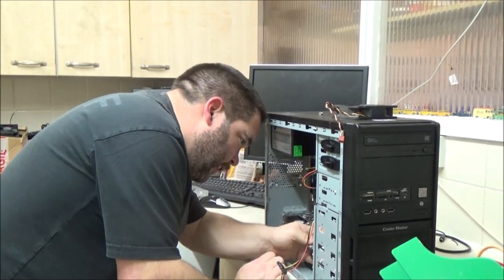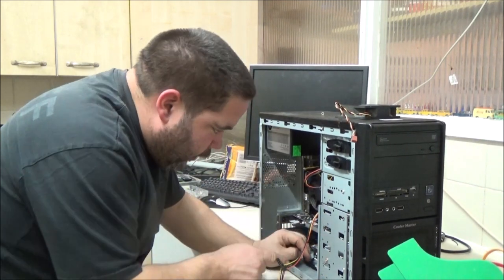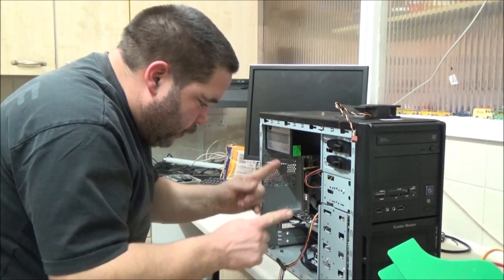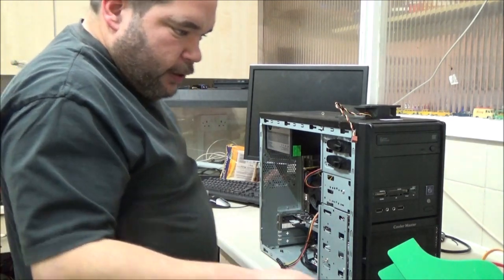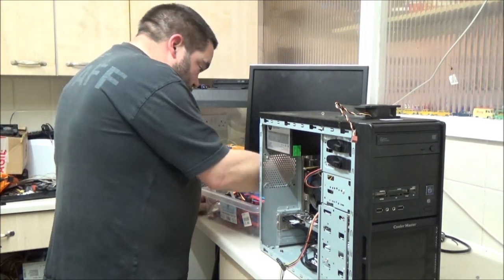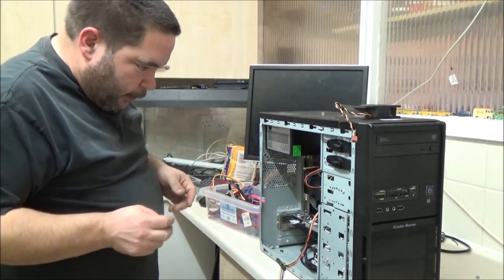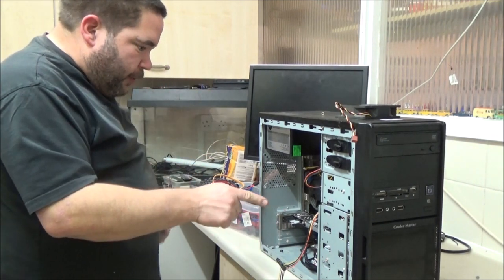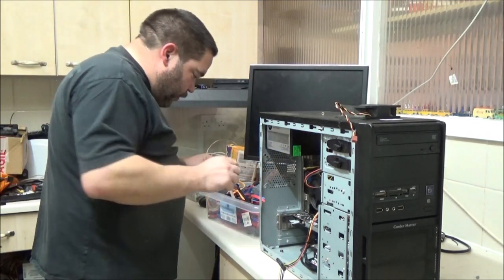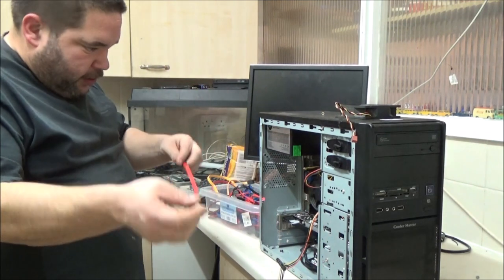As I do want it to technically be a usable PC. Right, so that's installed. I'm going to leave the ROM drive disconnected because I'm going to need the hand room to get the SSD in. So, actually what I could do is plug the SATA cable in now. Now, what colour shall I have for the SATA? Hard drive is the short black one. DVD drive is the long black one, so I know which one's which there. Don't really want to use another black one. I don't think I really need one this bloody long, do I?